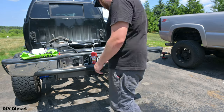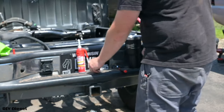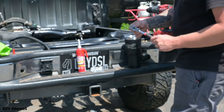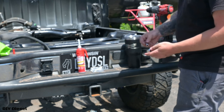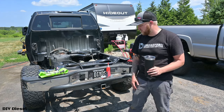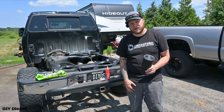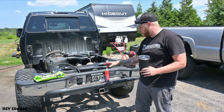Here is the dielectric grease I use at work and at home daily — I don't use the pre-packaged stuff. I also want to point out I use a nylon lock nut instead of a typical nut with a lock washer — nylon lock nuts are great when dealing with a lot of road vibration. For the M5 it's going to be an eight-millimeter socket. I'm using a Pittsburgh flex head ratcheting wrench and Snap-on sockets. I'm really a big fan of how this looks and how it operates — it's an absolutely perfect spot, way better than mounting it down low.